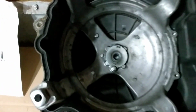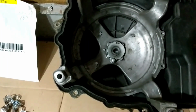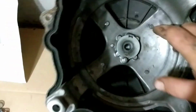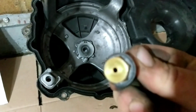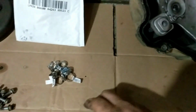so what I did is take the cage, flip it upside down as it would sit inside this housing, because it's pretty well impossible to guesstimate exactly where to drill your holes. So I flip it upside down. I actually did this last time. You can see my mark here. I set the cam plate in there too, just so I knew exactly where I could go. There's little divots in the cam plate. That's where I'm going to drill the holes. So I marked one there, and there's another one down here I marked. So I'm going to drill the holes, and then these guys are going to go in there. They got the rubber on the one side so they don't leak, and then they'll be strategically placed to blow the dust out.